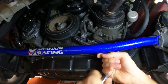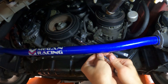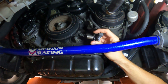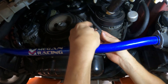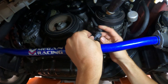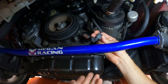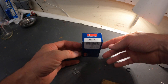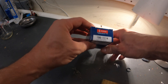To get it out you'll need an extension and a 10-millimeter socket. Jack the car up or put it on ramps for enough room to access it — it's just one 10-millimeter bolt, pretty simple. When you take yours out it'll probably be dirty because it's magnetic. This one says Denso on it and gives the part number, but in my case it's been superseded. They sell it at the dealer for about $172; shopping around, I got one on Amazon for $85. The part number is 196-1114 — I believe it's good for the 1UZ and 3UZ, but double-check that part number.